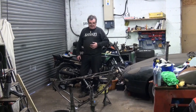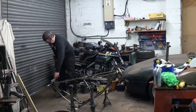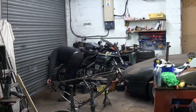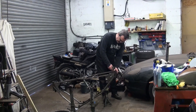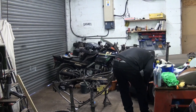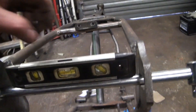So step two: it's been jacked up that way to this level, shimmed under there. When I put the level here, the bubble's in the middle. That tells me the headstock should be vertical at this point. Quick check proves that it is. And then if I take a bar, put it straight through the steering head without knocking the frame, and put my level on there - that's a shade out, it's a little off to one side.